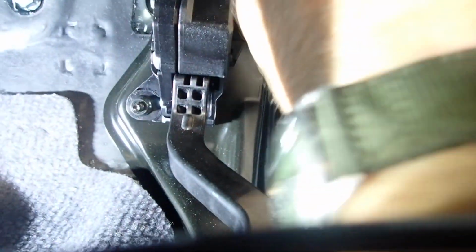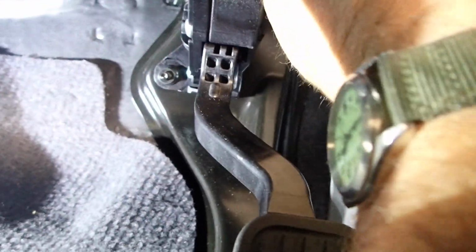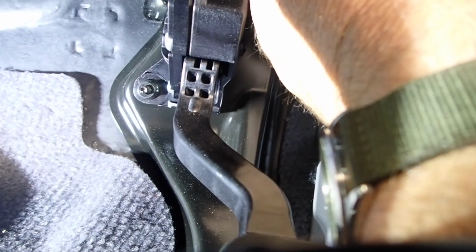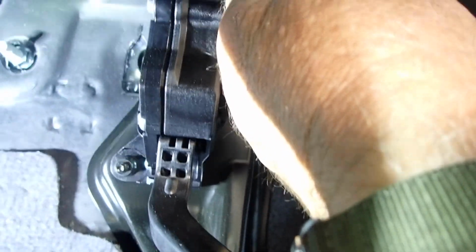Alright guys, a bit cramped under here for filming. So this is our power cable, and that weakened part in the grommet is where I'm aiming for. Now I want to come under this fly-by-wire cable. I don't want to be interfering with that at all. And that's the hood release. So I can come under there. Now I won't be able to get this armour through on the first pull. I might be able to get it through on the second. It's easier to come from the inside to the engine bay than the other way around, because there's a nipple on the other side.